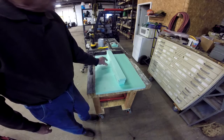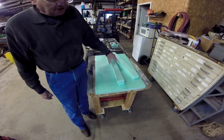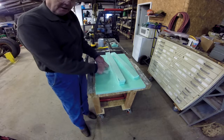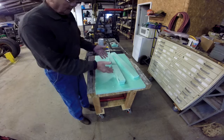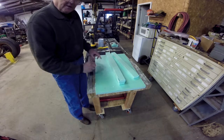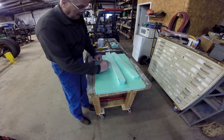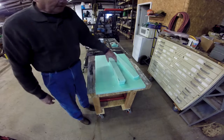One of the things that guides how tall this bottom section has to be is the bolts that go into the flanged area that secure it, because when this intake comes out, there will be bolts under here that have to be gotten into, so I need enough room underneath here to get the bolt in to tighten the flange up.